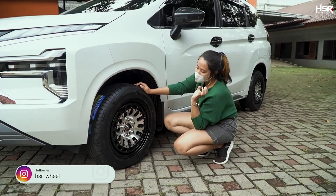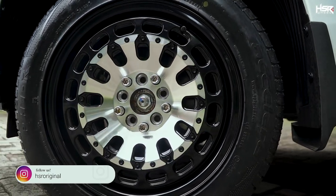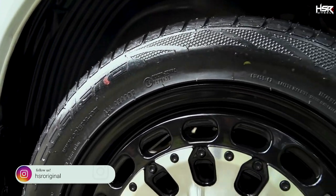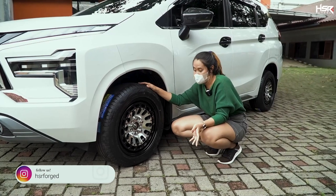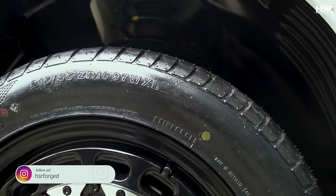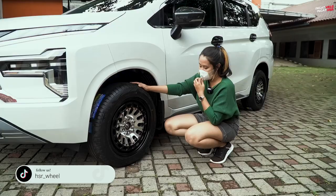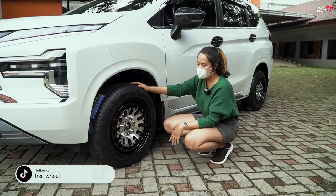Unlike the Siak which has a fully dark, black concept — where it blends in with the tire when driving — this one makes the silver stand out more on the road. For the tire, we're using Accelera PHIR size 215/55 ring 16. The MIT 07 is also dual PCD, same as before, so it fits both 5x100 and 5x114 bolt patterns.